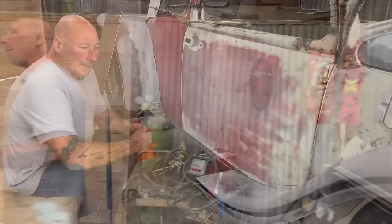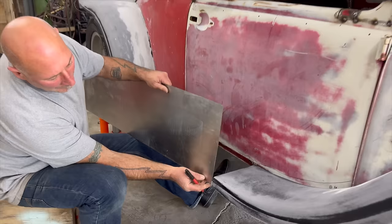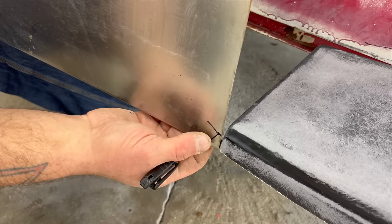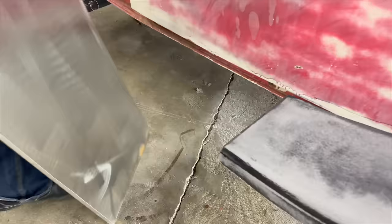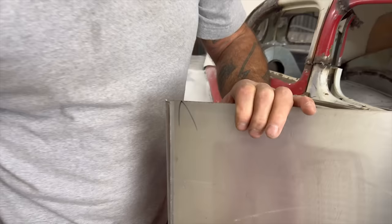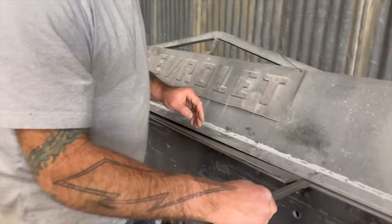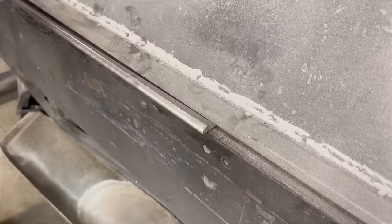Now we're going to look at this fender and compare. A lot of people doing proper layout and math would measure, but I don't think we need to because we can compare this. That's going to be the bottom right there — we're going to go right to there. This is going to be folded on the underside because we want this surface to turn in and then up a little bit, so we're going to be folding this way. I'm going to transfer that mark to this side so we can see it in the tool. I'm going to measure that mark from the outside edge and it is just under one inch. So we're going to come over here, push this in to just under one inch — not even a sixteenth, a smidge.